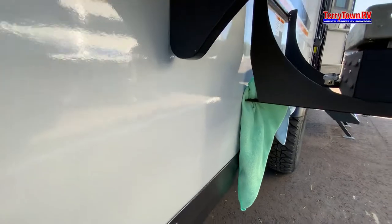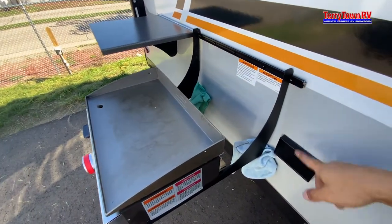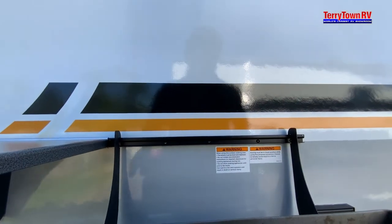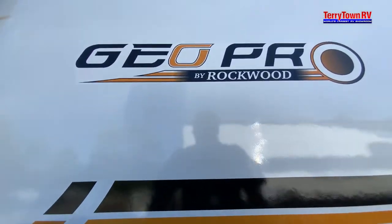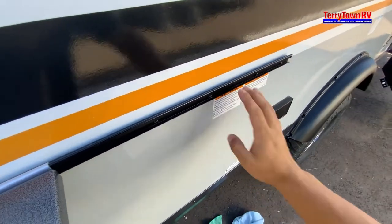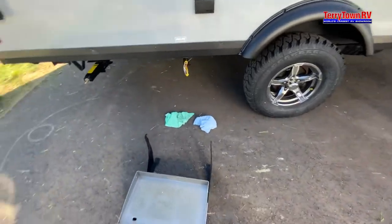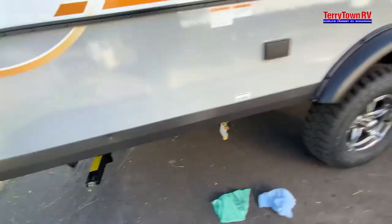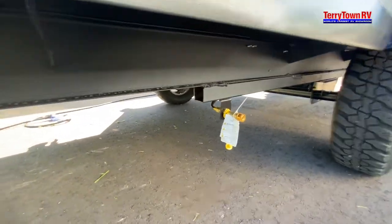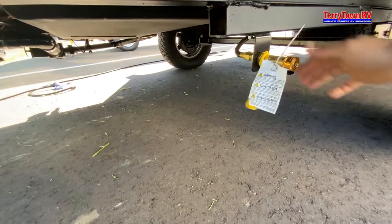The table and grill — I put some cloths behind it because I don't like putting my grill on my wall, I don't like having heat too close to my fiberglass, and I don't like the weight of it on my fiberglass either. The table legs go from the top part down — put the top part in first, then roll it down and it will hang on here. Below that, we have our LP quick connection. This is where you hook up a grill or any propane appliance — it feeds off those front tanks. There's a valve for on and off right there, the hose goes through at the grill, and you just push in and push the hose in.